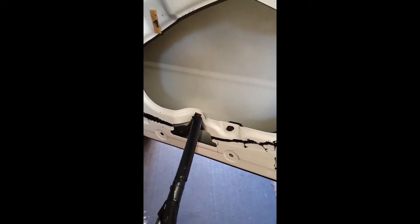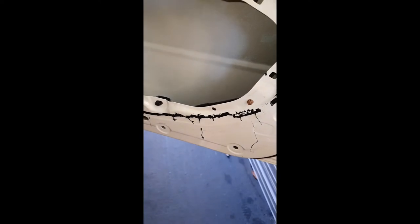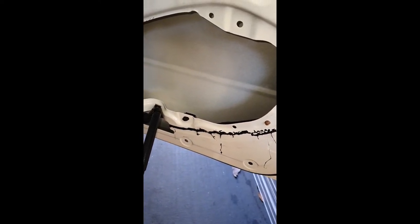Something else I should mention: right down in the bottom there is your drainage channel. All that brown down there isn't rust — it's dirt that comes down through the windows and handles. At either end there's an outlet — you can see a bit of daylight. That's to let water out of the door. Make sure you do not coat or cover that with insulation or sound barrier. These weep holes are very, very important — they must remain open. When you bring your sound batting down, stay about 25 to 30mm above it.